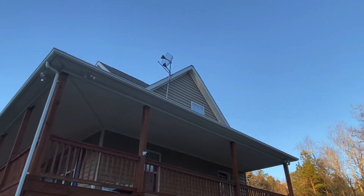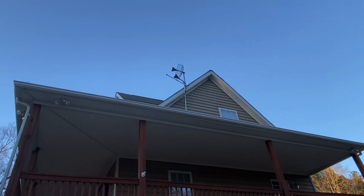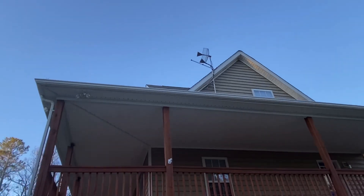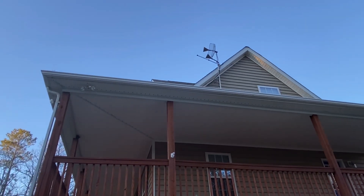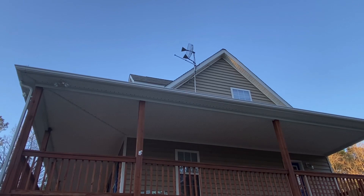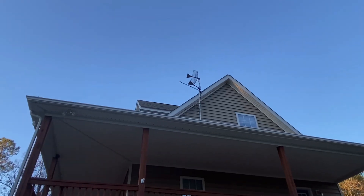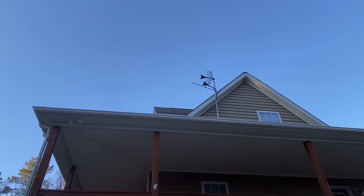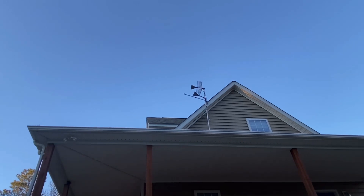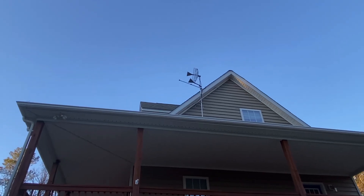There it is from a side shot — looks like I'm trying to contact aliens, but really just trying to game and stream. If you want rural internet and you're like me, you don't have to settle for 1.5 or 1 megabit DSL, or go with Viasat or HughesNet. Get a MoFi or a SIM router. They have cheap knockoffs for 150 bucks on eBay, or get a MoFi. Activate your SIM through your provider — if you have a grandfathered SIM, even better. Take it out of your device, put it in the MoFi, and the internet light comes on.